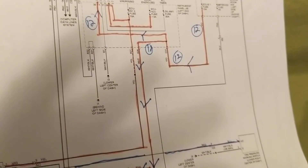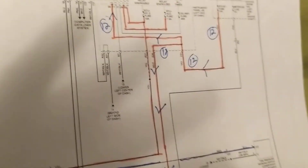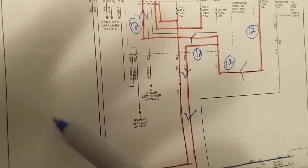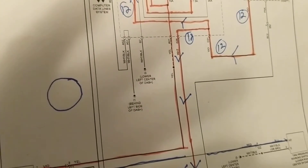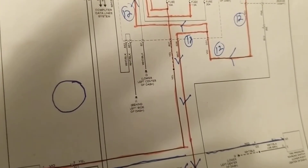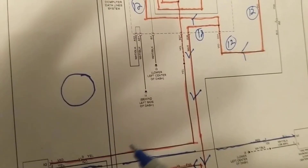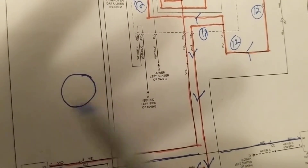There are two different patterns. One is the wheel speed sensor. If a tire is underinflated, the tire size changes — it gets smaller — so the speed increases. The wheel speed sensor detects that and signals that there's a problem with that tire.